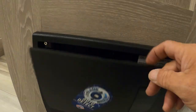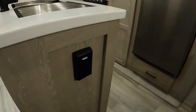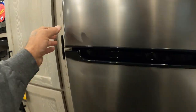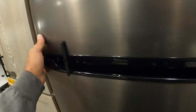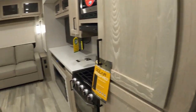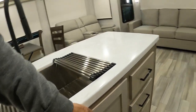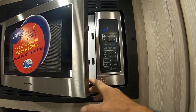Here in the doorway you have your fuse box — a ton of 15s, a 20, a 5, and another 20 — a little variety in there. Highly recommend having spares with you when you go camping. You have a 110 with GFCI reset on your island. Your Magic Chef fridge — all controls for that are indoors. This is a safety bar to keep the fridge from bouncing open as you're going down the road. Speaking of things bouncing — keep an eye on your plumbing. If you travel a lot, you're bouncing the house down the road, so make sure you're not getting any leaks anywhere.